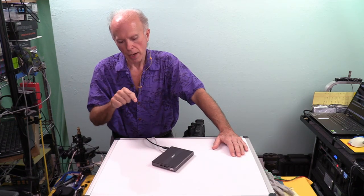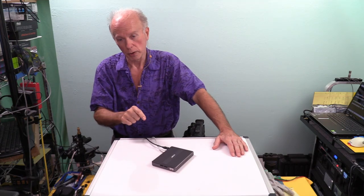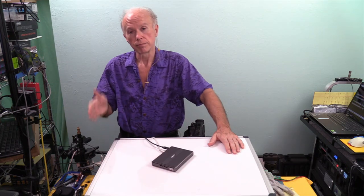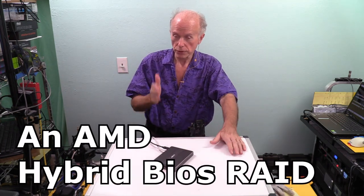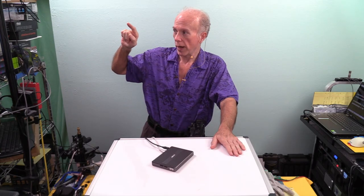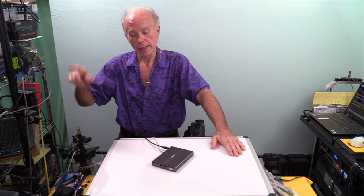What do I think of it so far? I'm impressed. But remember — they claim this is not a hardware RAID, but based on what we saw in the beginning, this should support hardware RAID. The concern is: if you set this up for hardware RAID and take that to another machine, because we're on Thunderbolt, that other machine has to have everything configured exactly the same — the same BIOS support. It's a lot simpler to move a software RAID. With a hardware RAID you need the card that does the RAID. Keep it simple, make it work.